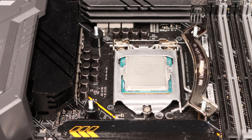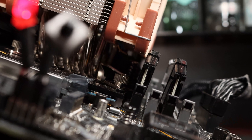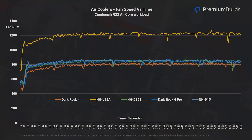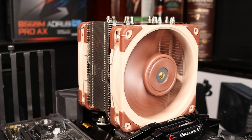The brackets are robust and you can fit the fin stack horizontally or vertically according to preference. There are no compatibility issues with RAM or a GPU on an M-ATX motherboard so it's a versatile cooler. Thermal performance is excellent as you'd expect and the fans are barely audible although they run at 1200 RPM, which is faster than the 140mm fans on the other coolers in this test. The fans aren't intrusive despite being a bit smaller because they're of exceptional quality. Temperatures are on a par with the larger coolers at 60 degrees Celsius. Noctua suggests using one of the fans to replace the case exhaust and in most configurations we'd second that as a great alternative to lower noise without harming temperatures at all.